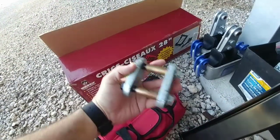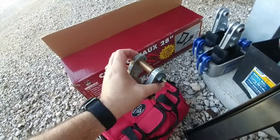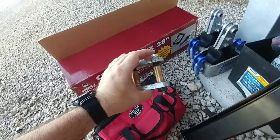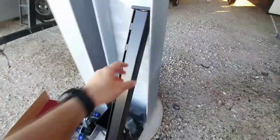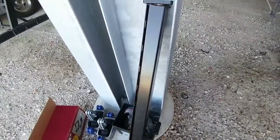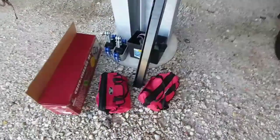These are the shackle straps that we are putting on — half inch thick, with grease zerks built into them, so these are a wet bolt kit. This should greatly improve the reliability of the suspension components. Here is that cross brace I was telling you about that will be installed — it runs between the suspension, it is a two-piece kit, they will be linked together and essentially act as a brace between the equalizer brackets. So we are going to go ahead and get started and put these SafeJacks to use.